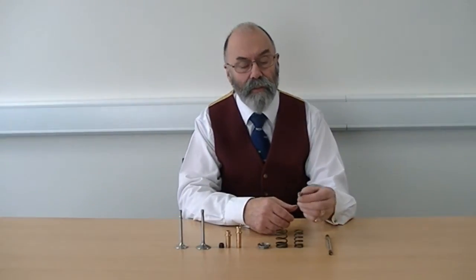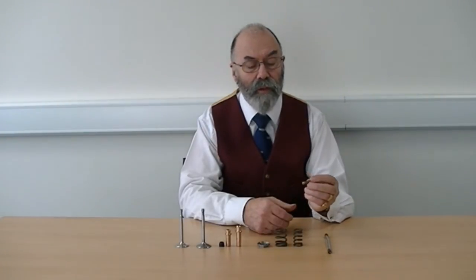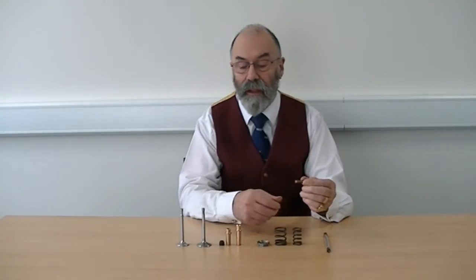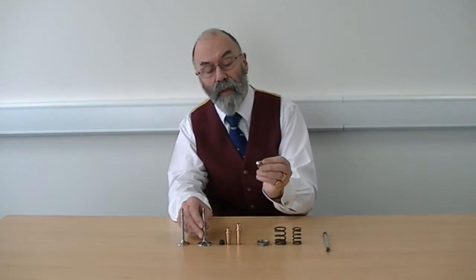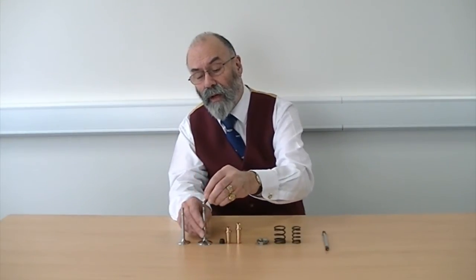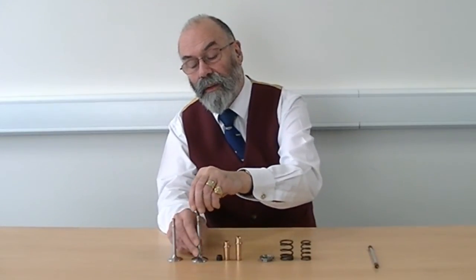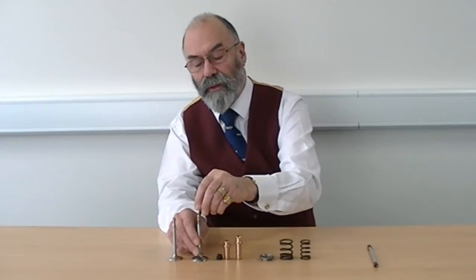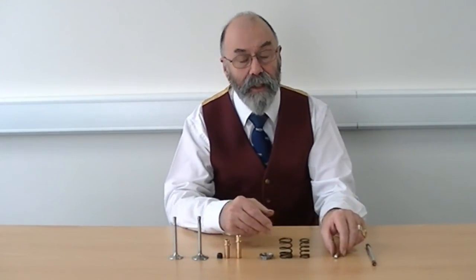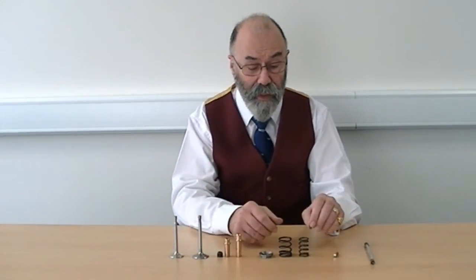This is the famous mushroom-headed tappet adjuster. We use these in the works bikes for 24-hour races. That beautifully mirror-polished head rolls with the rocker action across the valve rather than making a hole in the valve like the original ones do. That keeps your tappet gaps consistent for regular performance.